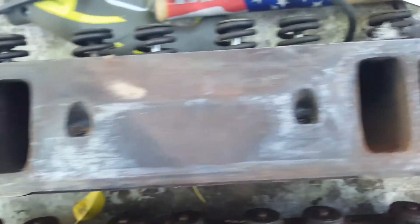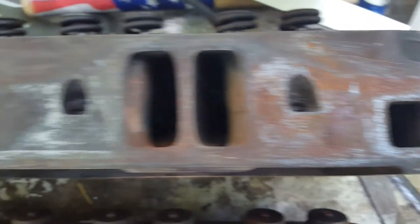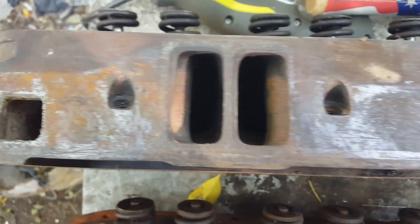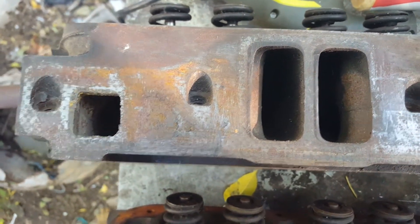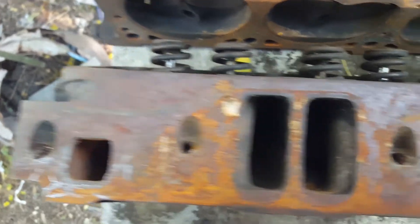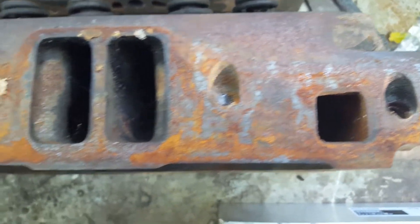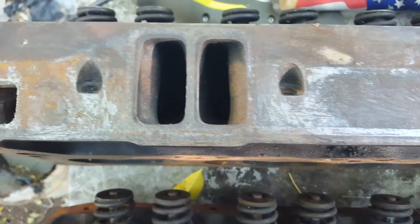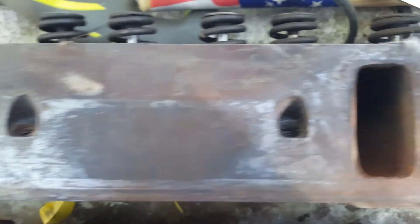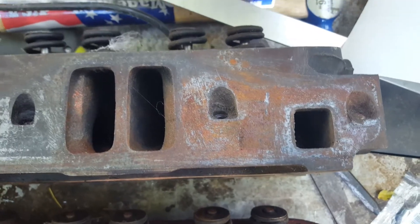Okay, here's what we got. What I've got right here is your standard run of the mill — probably cracked but still able to run — 360 5.9 Magnum cylinder heads. But I want to run an LA intake. This one has already been done and drilled from the last time I went through and built one of these, but I built it out of steel. This time I want to go through and make one out of aluminum, see if it'll hold up good enough to do what I need to do.